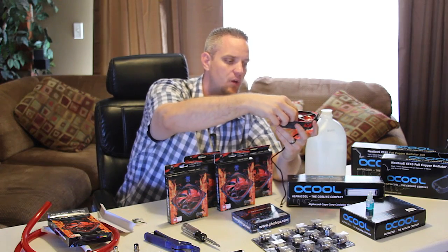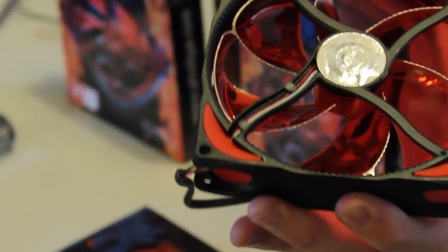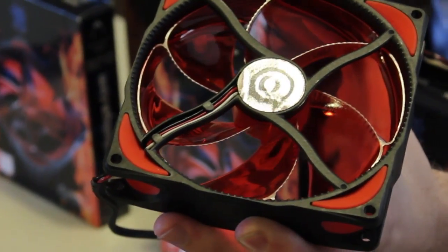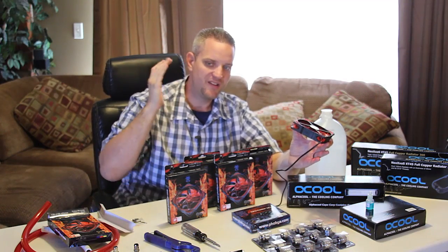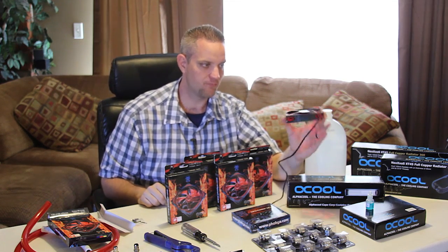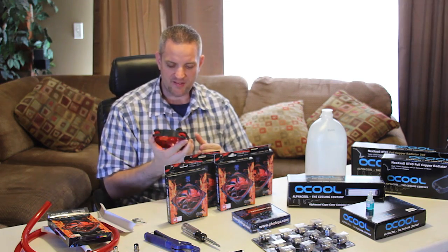And also, we have these little ridges here on the back of the fan. You can see them, they're kind of difficult to see, they're right here. These ridges are designed to break up some of the noise that comes with airflow. So it's not only going to channel the air more straight for higher static pressure operation, but it also gives a much more silent operation to the fan because it's scooping all of that air very cleanly rather than chopping the air, which is what a basic fan does. These fans right here are very cool. I cannot wait to see how these things perform.